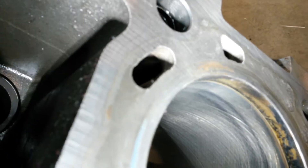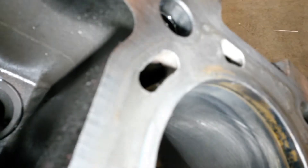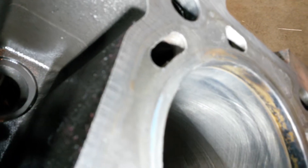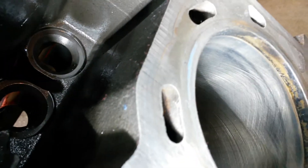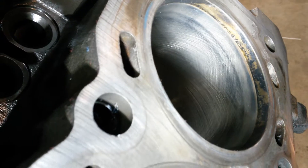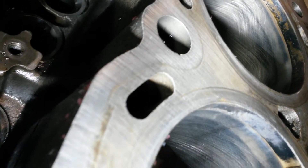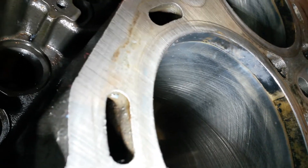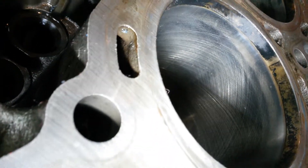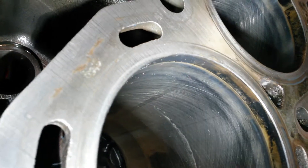There's a black water rebuild update showing the mill marks on the block itself. It appears as though it was decked, possibly a little bit better than OEM, but had blown gaskets twice. They do check out flat using the factory recommended procedure with a feeler gauge and a straight edge, down to one and a half thousandths. So the milling isn't too bad on the block surface.